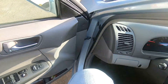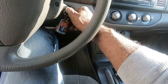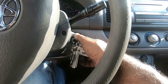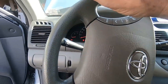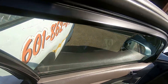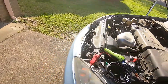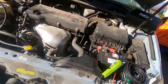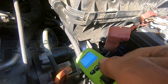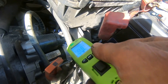Let me shut it off. Let me put it in all the gears — make sure it's not a neutral safety switch issue. Put it in neutral. I need you to get in the car for me and turn the key. We're going to do another test. This is turning out to be a diagnostic. Let me go ahead and poke a little bit in here — try to start it for me.